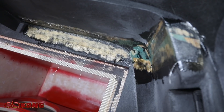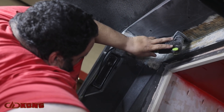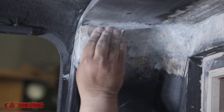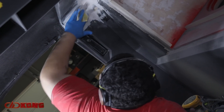In the later shows last season we noticed the truck was down on the meter, so we got to poking around to find where, and found out we had in fact cracked the faceplate effectively off of the enclosure. So the first fix was some fiberglass repair work to repair that in a sturdy fashion so we don't have to worry about that popping again, and then just a little bit of bodywork to hide it.